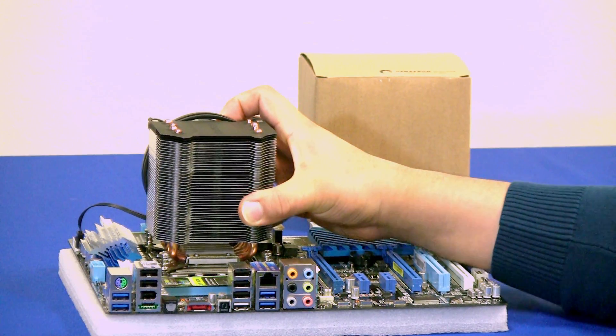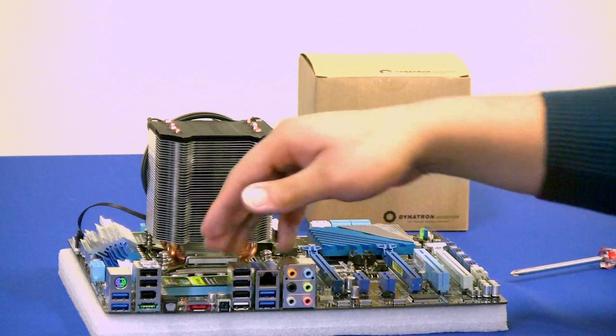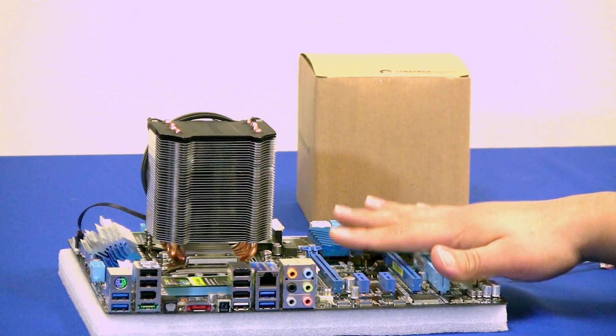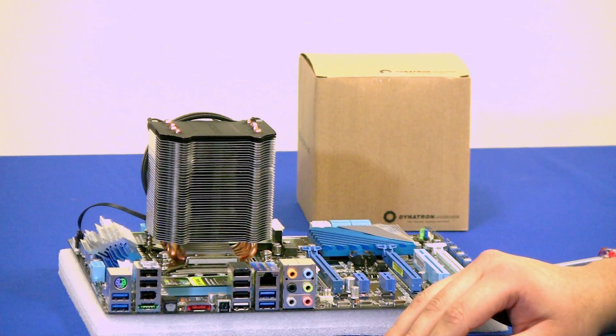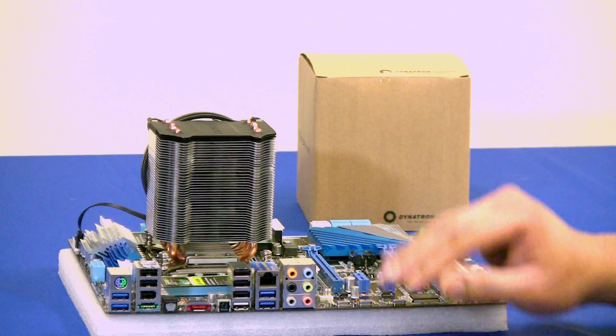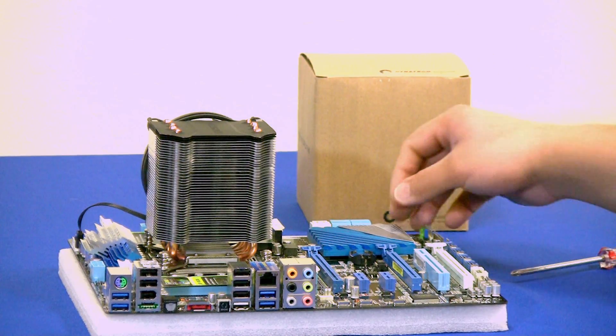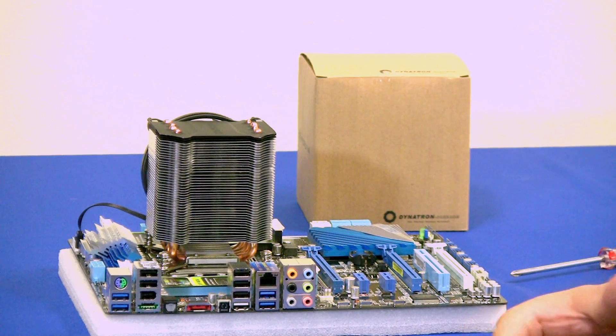This solution is rated up to about 160 watts. In most situations it will work great with our X79 standard series motherboards, offering solid cooling for stock operation and even moderate overclocking. It's a great cooler targeted at users of our TPU switch, generally looking at around 4.0 to 4.3 GHz, while still keeping the CPU well within normal operating temperatures.